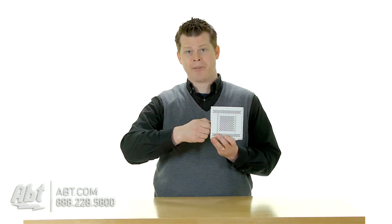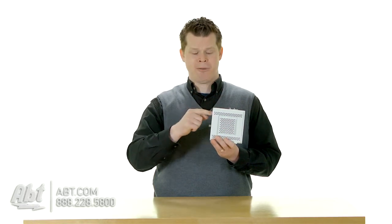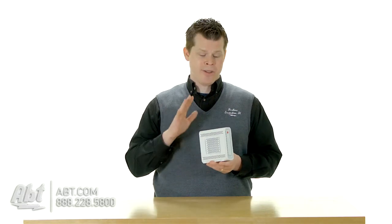It's a quick, easy setup as far as physical goes — you're just going to screw on your coax cable from your internet, and then if you want wireless, this is not a wireless modem, so you're going to run a CAT5 cable to your wireless router. Save a good amount of money by having your own modem, and you might even do what I did and get a faster connection.